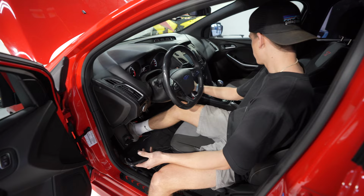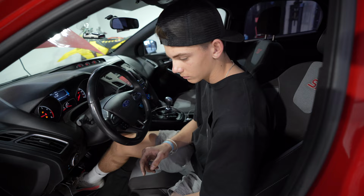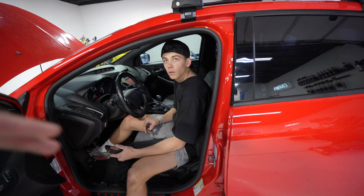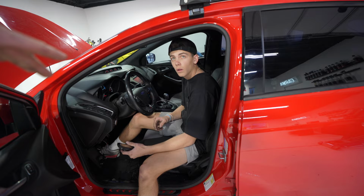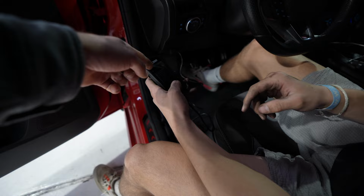So, Alan asked you to turn on some things to monitor for him to be able to see on the Accessport, and those only. When you do a data log, you can record like 100 things. He's asking you to record like 15. It's in the email. So you go up to the top, configure data logging. Look at the email, then click one. It turns green, and click it again, it turns off. Make sure that only the ones he asked for are selected.